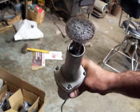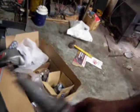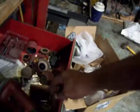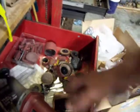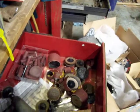These little pads here work great for cleaning surfaces up, gasket surfaces. I used carbide tips a lot on the intake and on the heads. That wasn't expensive. By the time you buy all that, you might have $100 in it. Reminds me I need to get some more of them little pads next time I'm down there. Just really comes in handy.